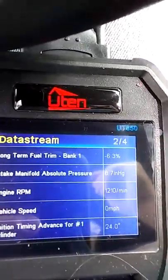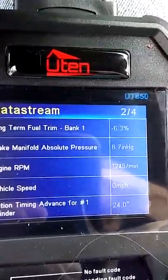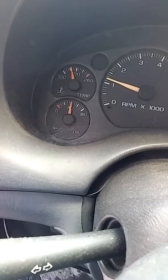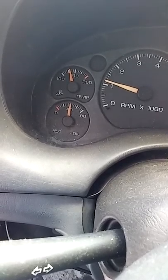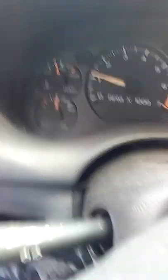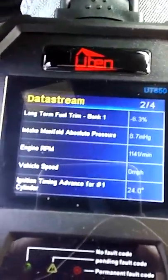The issue is whether it's blowing oil out of the main seal or somewhere — I've got to check that. I thought I had every bit of it cleaned out of the bell housing so it might not be doing it now. But I was running 80 pounds of pressure before. This new oil pump, identical to the one the motor first had, it runs right around 40 pounds, and at idle after you've driven for a while it's down to about 32-36 pounds. So let's take a ride and see what's happening.